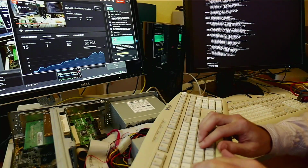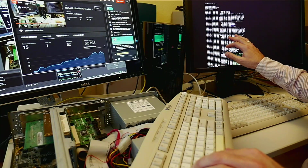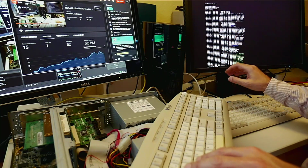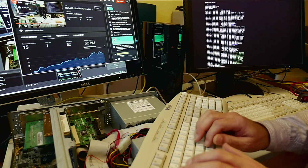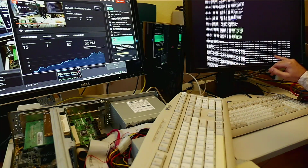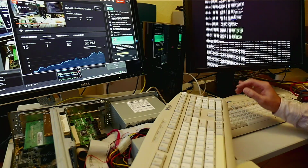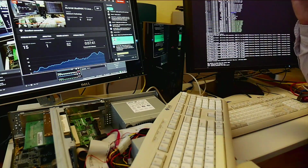Hey, we finished compression. Let's see, what is the size now? ls. So that is the initrd, significantly smaller, only 8 point something, so that may be more bootable. Let's see if that is the issue. Otherwise, we could file vmlinux, all of them. These are all 64-bit SPARC, SPARC v9, not stripped. Is that right, that we're not stripped? Anyway, let's give this reboot one more try. So not Control-Delete on the wrong keyboard.